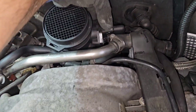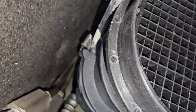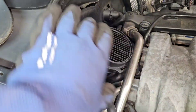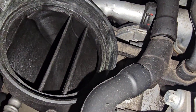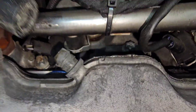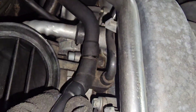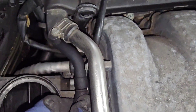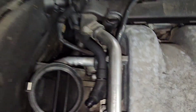The connector comes loose just like this by pushing on these two tabs. One spring clip behind, over here for the airflow meter, and then the airflow meter should come loose - put it aside just like that. You need to make sure when putting it back you include this washer; there are a few positions with indentations to fix it. Let's remove this from here - it should be pretty easy, just like that. And this one is not in good shape. Remove it from this side by just pulling on it - a bit of twisting - and there we go.